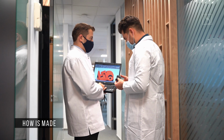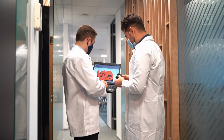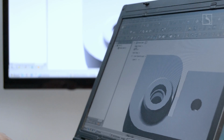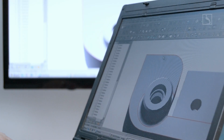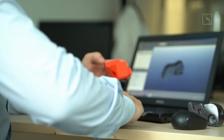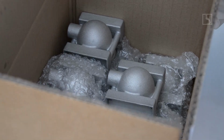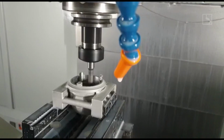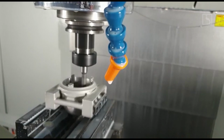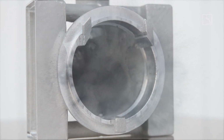Before going to install the headlights on the vehicle, let's see a quick overview of our development process of this kit. Just like we presented in the Jaguar throttle body project, we first accomplished a requirements set. For this we performed adjustments in a loop for several 3D print versions until all the dimensions and functionality were a perfect fit. Just after, we designed the molds and obtained the first wax patterns. We got into metal casting from our supplier. Then we did the CNC machining for cable ports, PCB slots and sealing rings. As the final step we completed the finished product by electroplating then powder coating.